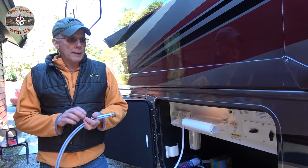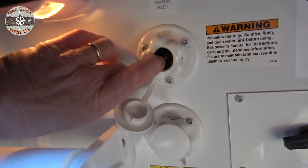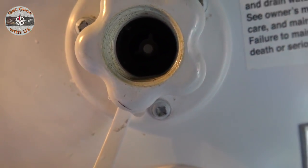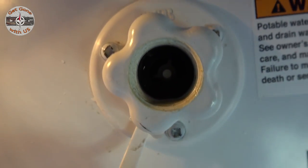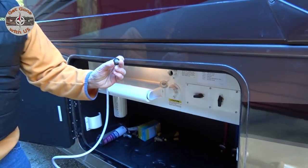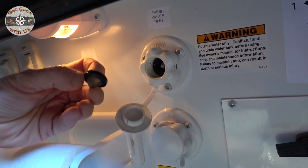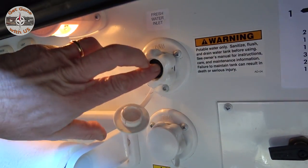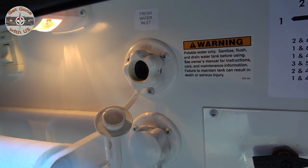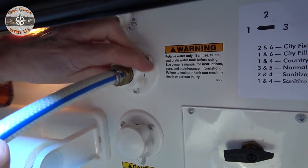We did find out online, somebody discovered that in here is a siphoning valve and it pushes in. It needs to be sucked in by the water pump in order to get the antifreeze into it. I'll try to take a picture of it later. This is your strainer that normally sits like this in there. If you take it and flip it around and put it in, now it's forcing that valve to be open. See, there's actually water still in the line. So it will suck the water in a lot easier. And then just put your siphoning hose on.